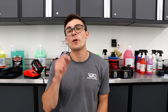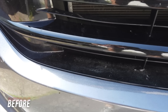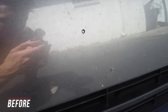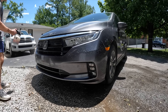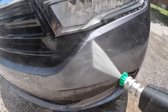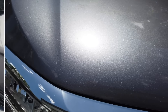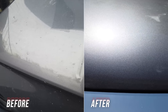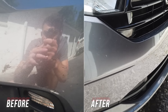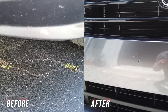To highlight the versatility, I'm repeating the exact same thing with gray paint on the front of this minivan that rarely gets detailed and is covered in bugs. Once again we've got plastic, clear coated paint, and black trim both porous and non-porous, soaked in the 10 to 1 Dark Fury. Allowing time for chemical decontamination in direct sun on even hotter paint, it is still ripping off those bugs no problem. The before and after side-by-side is dramatic.